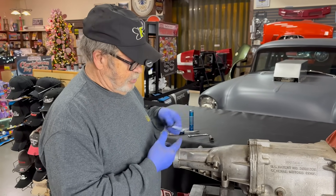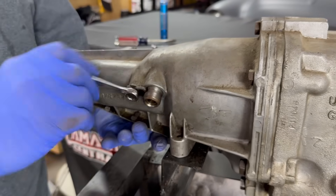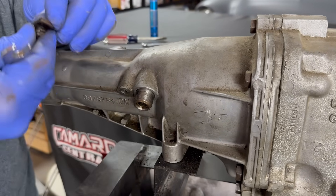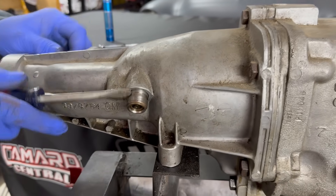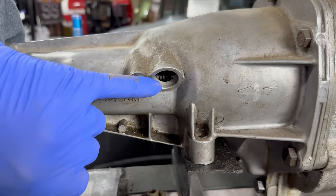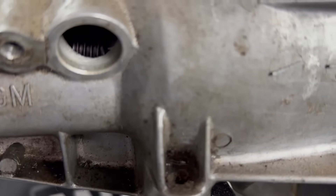You'll use a 7/16" wrench. After you disconnect your speedometer cable, which unscrews here, use the 7/16" wrench to take out your retaining clip. Just pop it out with a screwdriver. There's your gear, and you can see the gear that's on your main shaft on your transmission, which turns this gear here.